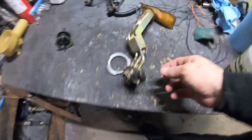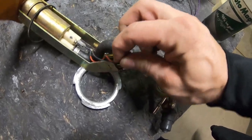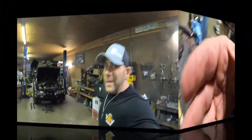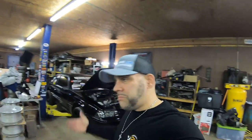And I keep reiterating the wired pump because everybody knows that Foxbody wiring sucks. So relying on that 16 gauge wiring in a fuel pump to feed a lightly boosted modification, guys, that's just not gonna do it. It's just not big enough. The more amps you put on the pump, the more efficiently it works. They tell you that in the directions with the 340. You wire the pump, you get more amperage to it, you get more flow out of it. That's just the way it works.